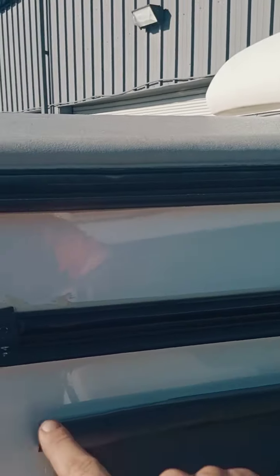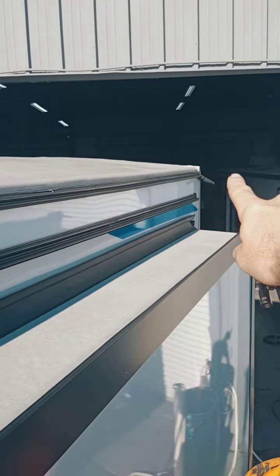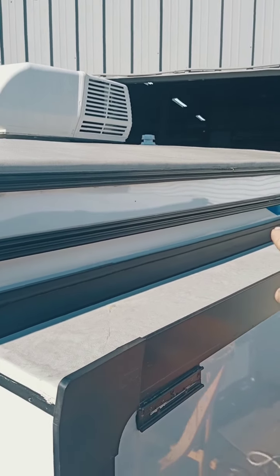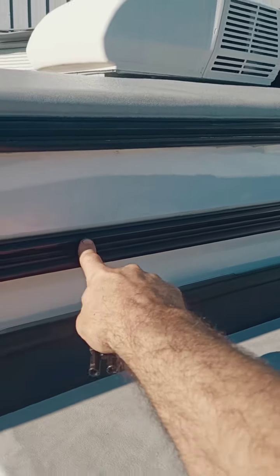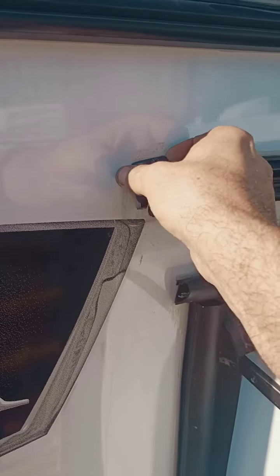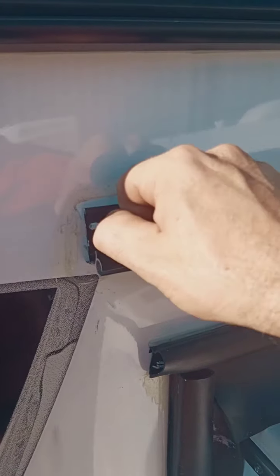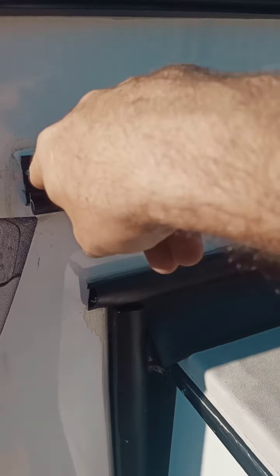All right, so here's the drip rail — this is the top drip rail for the whole unit, and this is the drip rail for this slide-out in particular. Some will have a separate drip rail for this slide room because this is where you would attach a slide-out awning. We'll get that screw out, take this little cap off, and peel this trim back just a little bit. Right where this screw hole is, we're going to be putting the rain gutter behind there and then securing it back through that same hole.